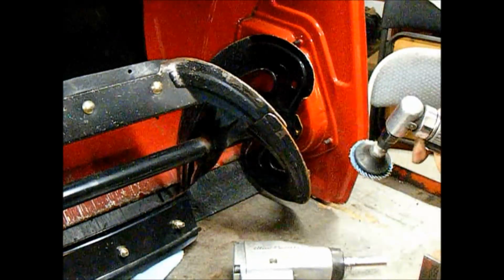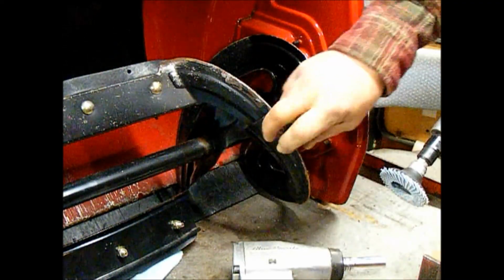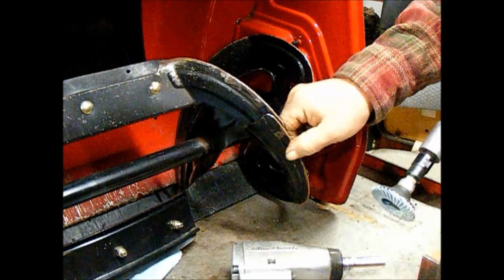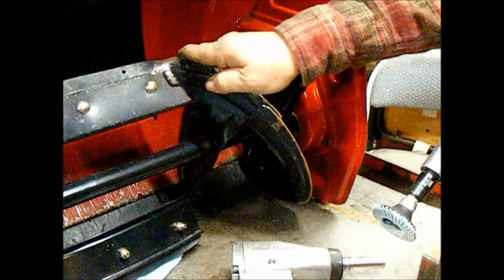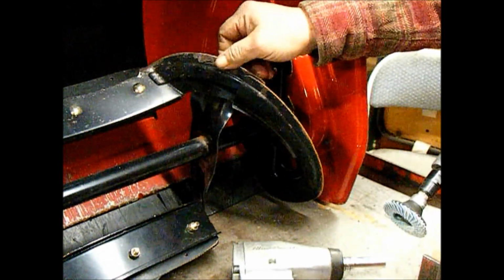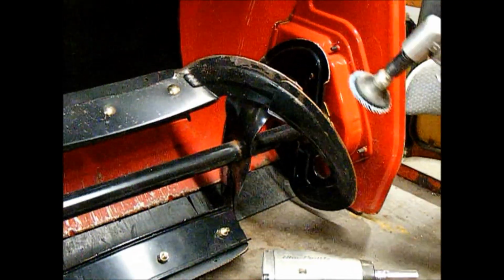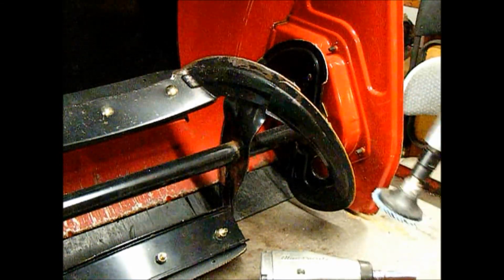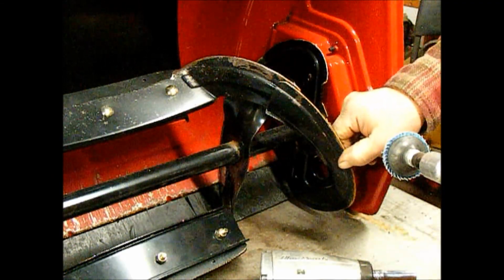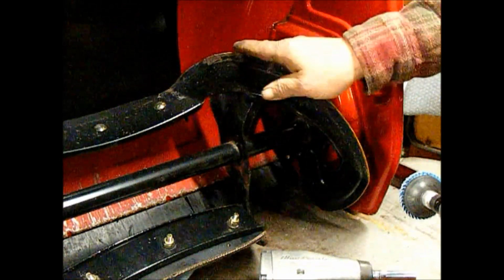there's a million and one uses for them. The Scotch-Brite pads are good for gasket removal. You have to be careful though if you're removing gaskets off an aluminum surface, because if you hover in one spot, they will chew into the aluminum. But other than that, as long as you don't apply too much pressure and you keep moving, they work very well.